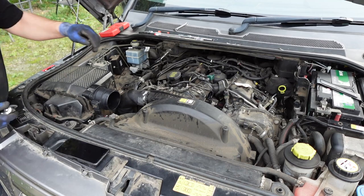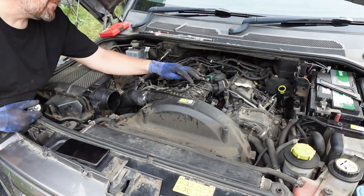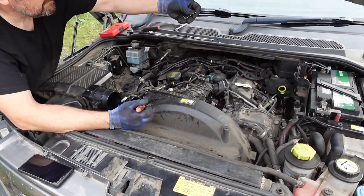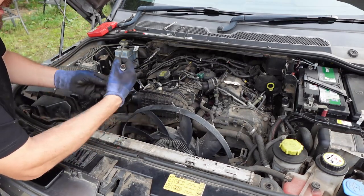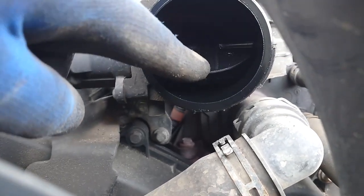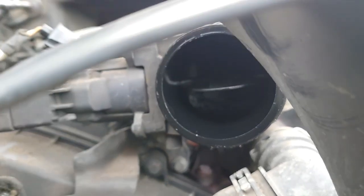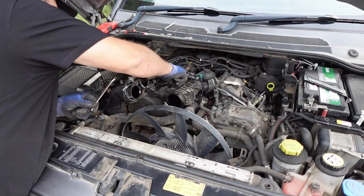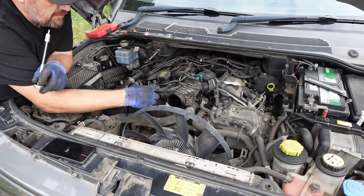Let's get the blanking plate on the bottom here. There's not a notch that I can see, so I'm not too worried. There is our plate down there, just going to do those up now. We're going to pull — there's a retaining clip in here that pulls this intake box away from the butterfly housing. We've just got one bolt which is just here. And in here you'll see is our butterfly, and we need to remove that. We need to remove that butterfly so it's free flow the whole time.